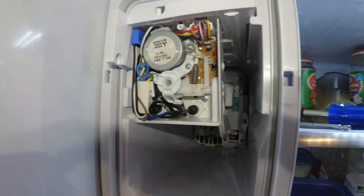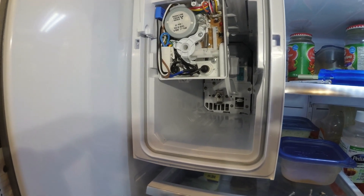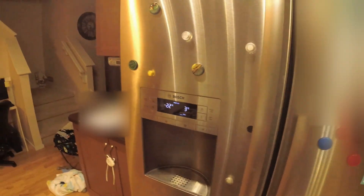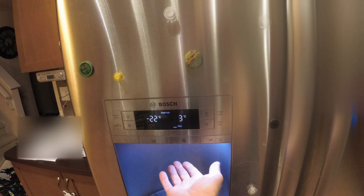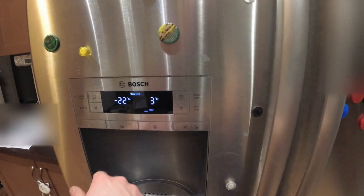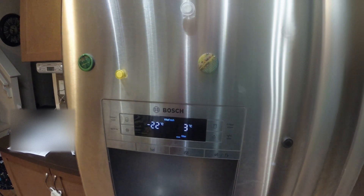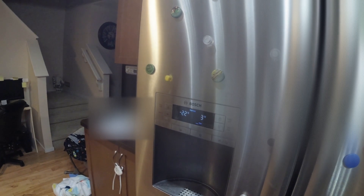As I said in my previous video, I also checked the water sensor on the back of the fridge. There are two solenoids on the back — I switched the water solenoid and the ice solenoid. The connectors on the back both look the same and the connectors fit in. Then I had someone come up and hit the water and I could hear the water going through my ice maker solenoid, so I knew that was fine.